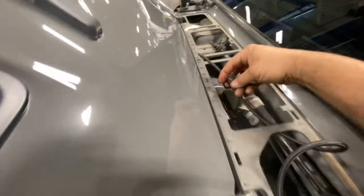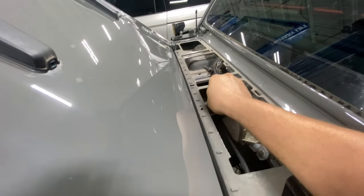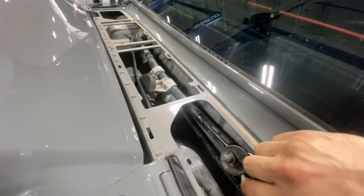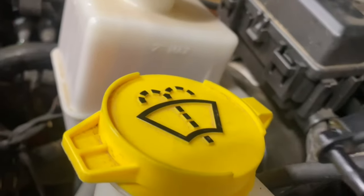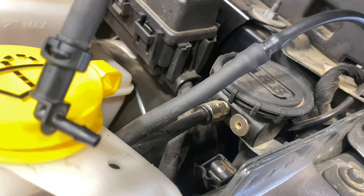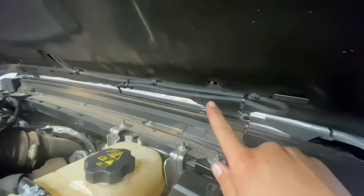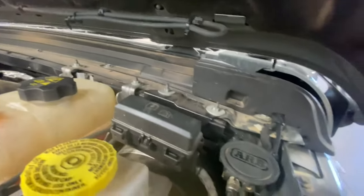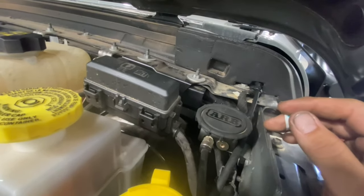You're going to go above the wiper motor, and then kind of lay it on top of that right there. So when you put your cowl back on, you can feed that through — there — so there's no 90 degree bend in it. I'm going to keep the 90 degree bend on this, so just pull this out of the rubber and then tee that in. That way it's nice and tight. The old wiper hose I just double zip-tied up out of the way. The new hose is routed down right here, going in here. I put a single zip tie right here to kind of hold it together. Let's close it down and put the cowl back in with the wipers.